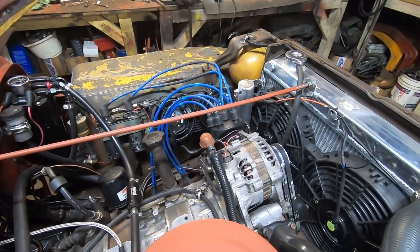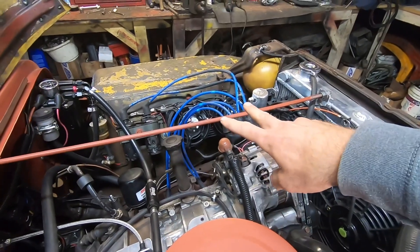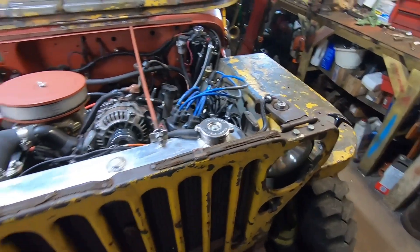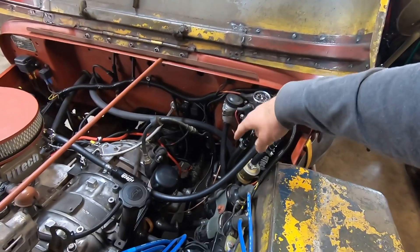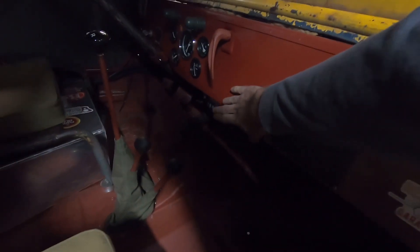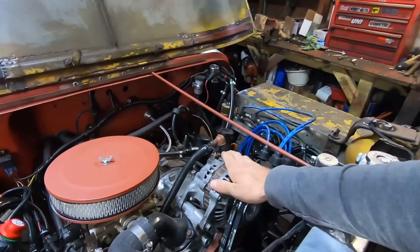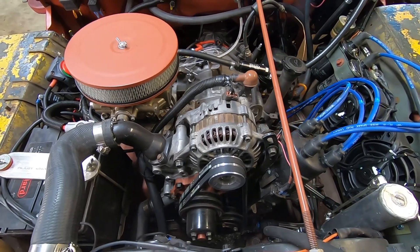The rotary makes a lot of heat and I don't have room for a mechanical fan or a huge radiator, so I'm running fans — two electric fans on the radiator and two electric fans on the oil cooler. That's really important to keep this thing alive on the trail, especially when we're moving slow. I have converted all the bulbs on this thing to LED, so I am saving some power there. I do have a winch on the front. It has a high pressure fuel pump and a low pressure fuel pump between that and the tank, plus a bunch of relays. I installed the Inferno cab heater, which works great but definitely takes a lot of juice. So if you add all those things up, my alternator is completely maxed out — and if you turn on the winch, it's maxed out three times over. The stock alternator is rated at 80 amps, which is fine for the original car this engine was in, but definitely not going to cover all the accessories I've added.